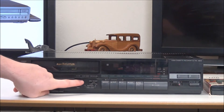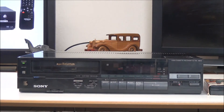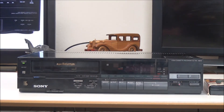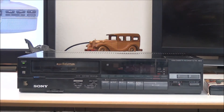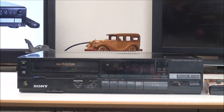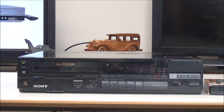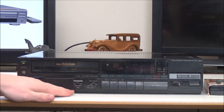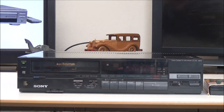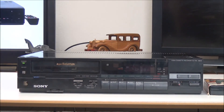You can turn on and off Super Beta. The Super Beta switch is used to improve the picture quality of any tape — so if you put in a standard tape, the Super Beta option should upscale it at least slightly. For recording it's going to provide a sharper image. If you plan to record from cable television onto a Beta, you'll want this in the on position for the best quality picture. But if you plan on playing back the tape in a non-Super Betamax, you'll want that in the off position so you can play it back later.